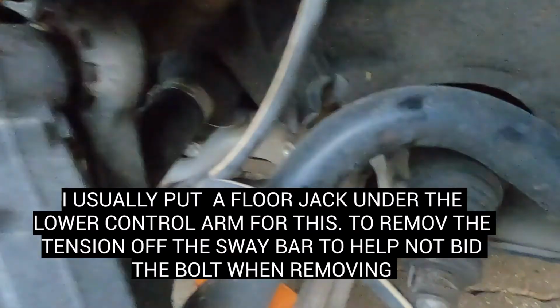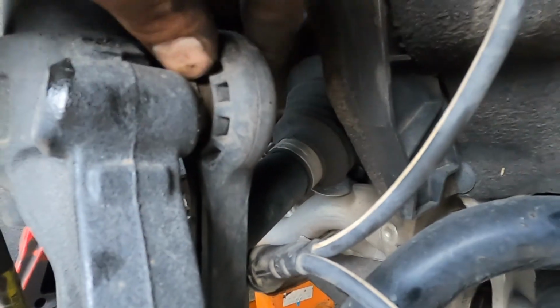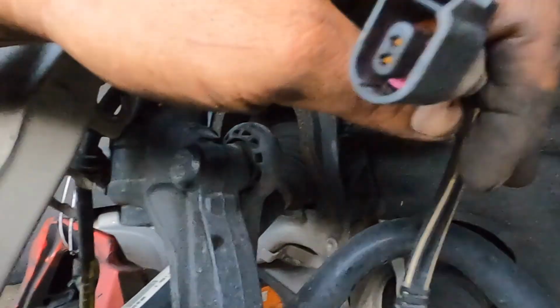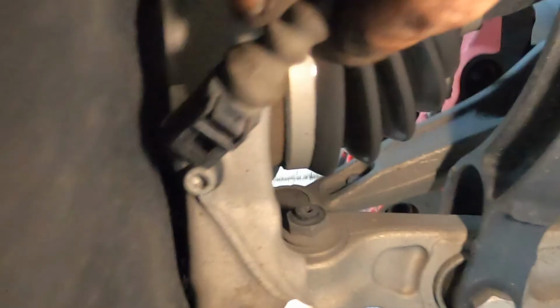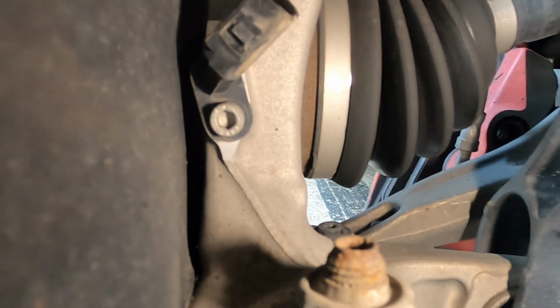All right. Second, you're going to want to remove this bolt right here, which I also filmed in slow motion. And third, to get you guys fully caught up, you need to remove this sensor from that spot right there. All right, and the trick to getting these off, if you push down and then pull your tab, they pop right off. So, set that off to the side.